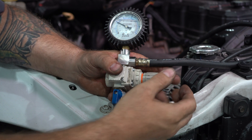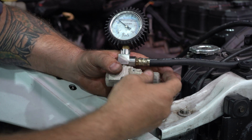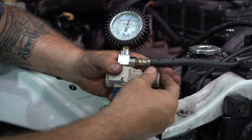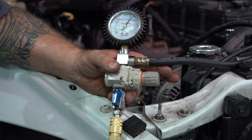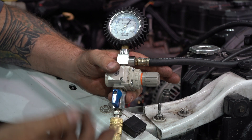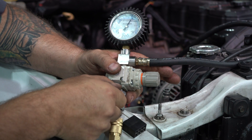I'm going to start going up to ten. At ten I don't really hear any big leaks, so I'll push it up to 20. Right around 20 PSI I'll leave it there. I recommend leaving it there for about 30 seconds to a minute before you shut any of your air off, because that's going to put a lot of air in the system and pressurize the whole system.